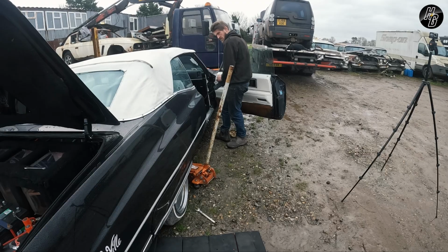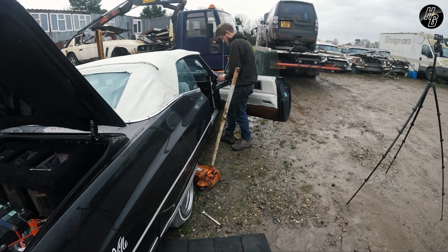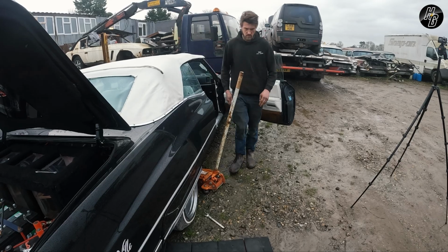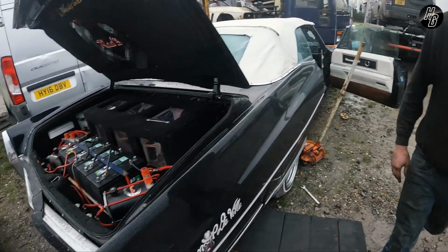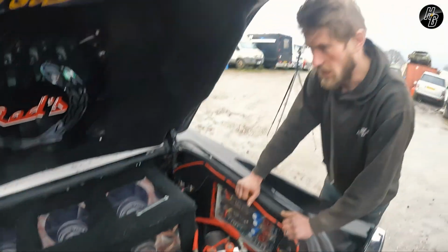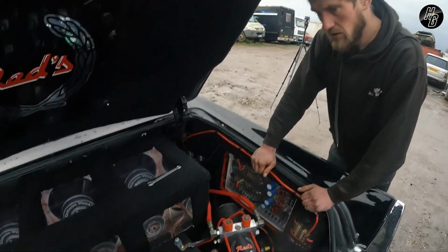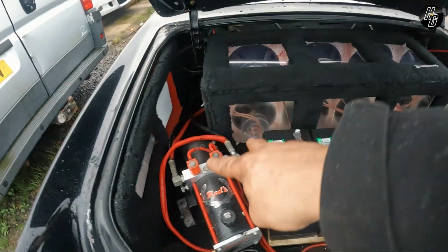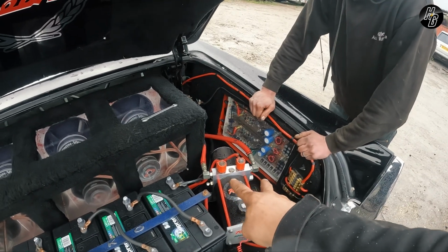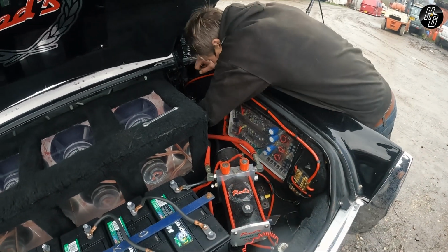Okay. He said what we can do now is swap our pipes over from the fronts to the rears, yeah? And then we know the fronts go up and down, yeah? At least one off, yeah. No, we do, because the fluid goes to both. So now if we whip these two pipes off and transfer them to this pump, that will tell us if they're working or not.